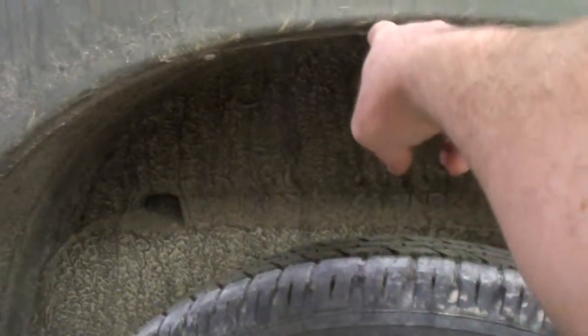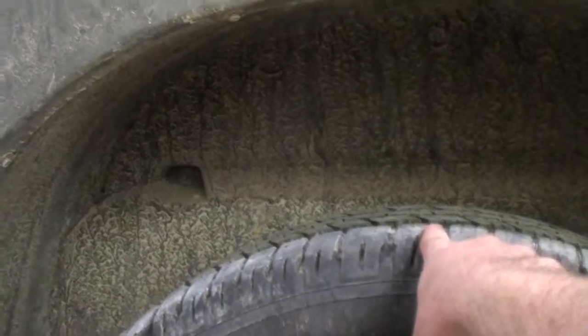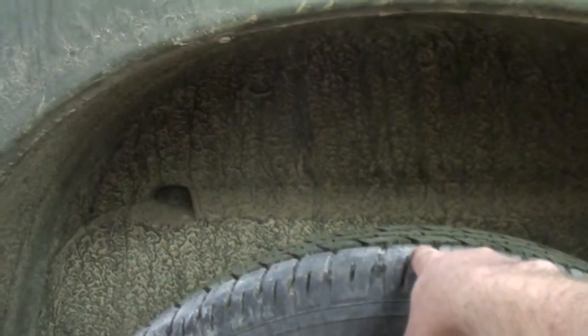One thing I can tell you, as far as setting these springs, to get an idea of where your springs need to be, or how much air pressure you need to have in them depending on your load, if you're hauling the same load all the time, the easiest thing to do is to measure unloaded, measure your distance from the top of your tire to your inner fender well, okay? Now Airlift recommends airing the springs up before you load the truck and then removing air to get your desired ride height. So definitely that is their recommendation. I don't know what would happen if you tried to load the truck and then air them up. I don't know if that's going to cause an issue or not.